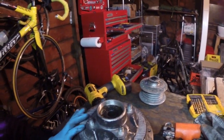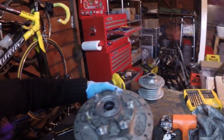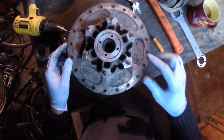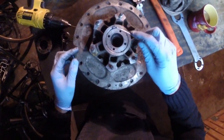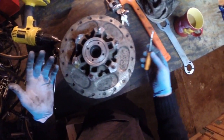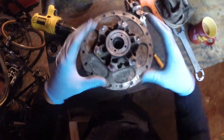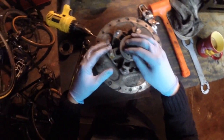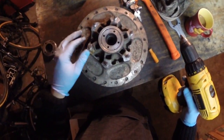So this is the front side. I'm going to show you how to do the other side now that I've done one. I'm going to put the camera on my head here. So the first thing is there are these four peens - one, two, three, four. When Honda built these, there's a cover and a whole bunch of stuff that comes on. All it has to do is come back and snug, but they just kind of over-engineered it and peened all these things inside.